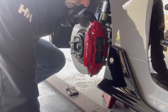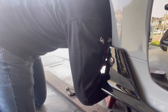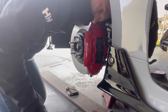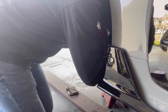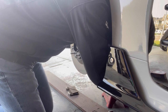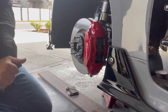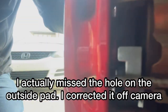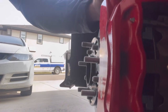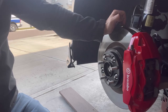So you're just going to want to tap your pins back in — maybe use a punch so you don't chip your paint. It's a little tight in here. On the backside, I just made the pins flush. Those pins are now flush, sticking out just a little bit. And that's it — out with the junk pads, in with the new.